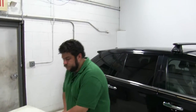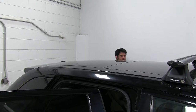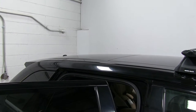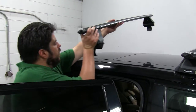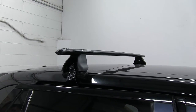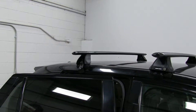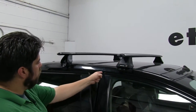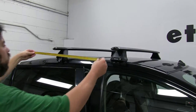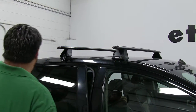Now we can open up our rear doors and set our rear bar into place. We'll just set them down without measuring yet, just get them kind of in the position where we need them to be. Then we'll take our included measuring tape, measure out the distance of our crossbars, and this is going to be from center to center. How we came to the measurement for our front crossbar is we measured from the center of the door jamb out to the center of that. Again, you'll find this measurement in the instructions. And we'll repeat this process on the other side as well.